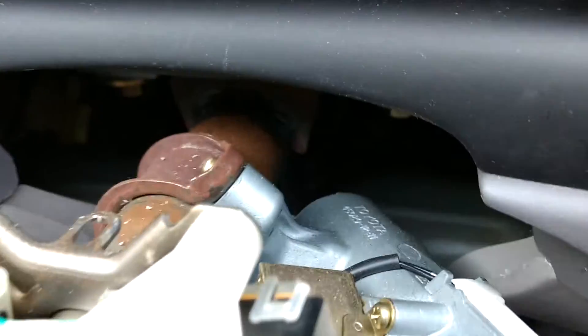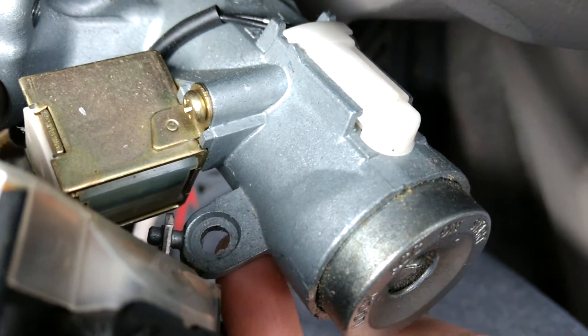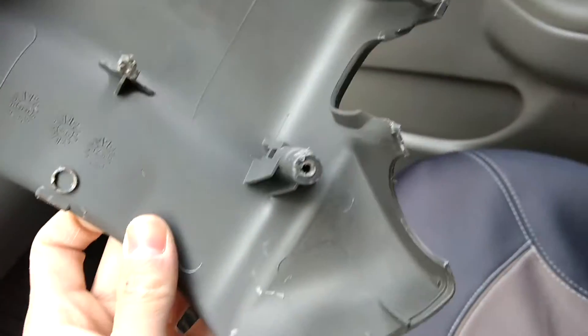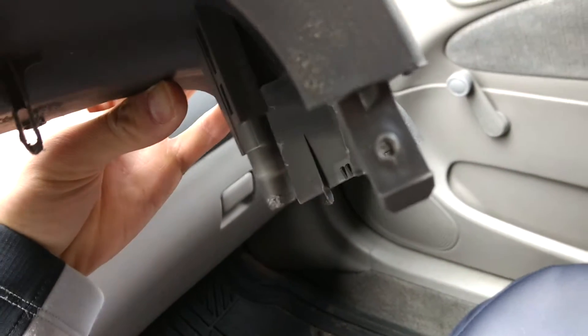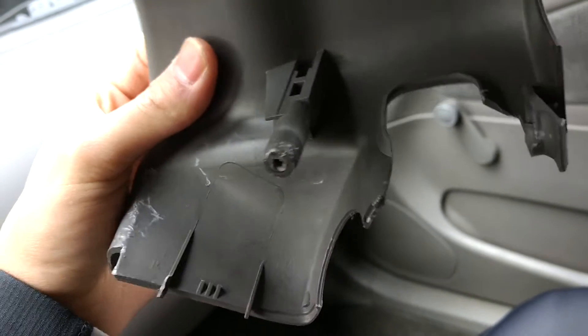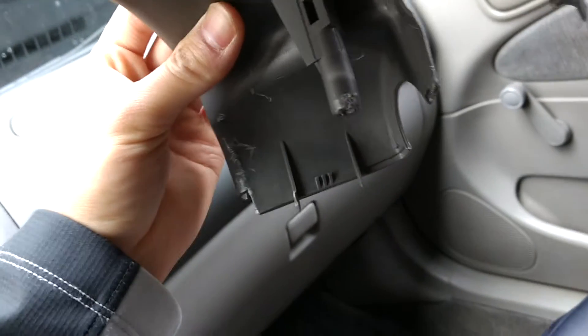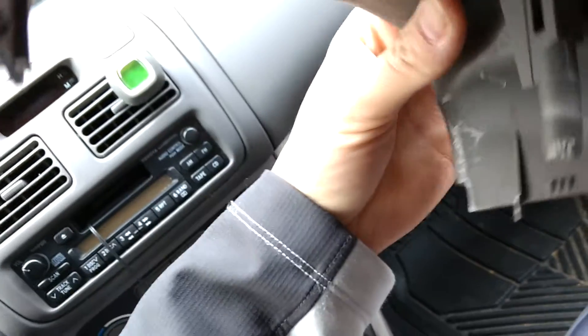The most annoying one for me was up here next to the ignition through this hole. There's a small black self-tapping plastic screw that mounts onto the female portion of the top cover right here. It was extremely annoying — I felt like I was going to break something. Make sure you take out this screw before you actually break the steering column cover and end up having it rattle on you every time you drive, or needing to buy a new one.